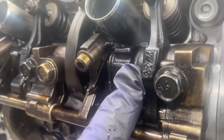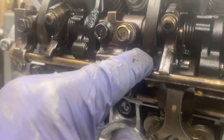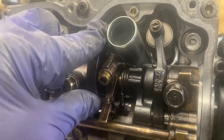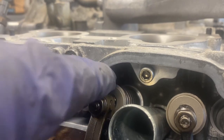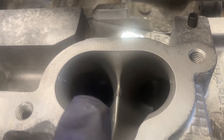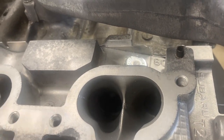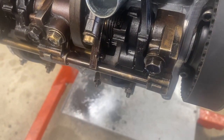these are your rocker arms, and as the camshaft spins around, the lobes or the bumps on the camshaft push on this end of the rocker arm, which is basically a teeter-totter, and then this end of the rocker arm pushes down on the valve, which opens up the valve, which you can kind of see in there with horrible lighting. And as that little stick down there with the valve head on it goes in, it allows the intake gases to flow down through, and then the valve in the bottom allows the exhaust to flow out.